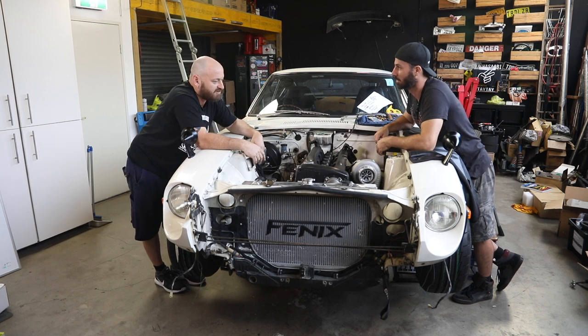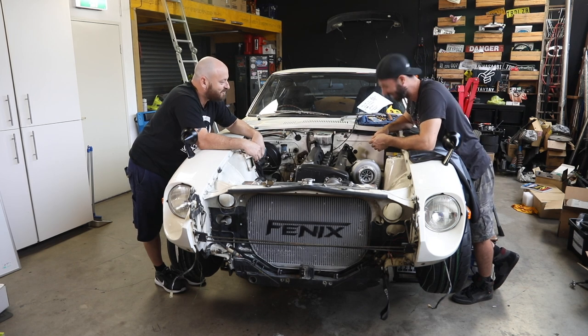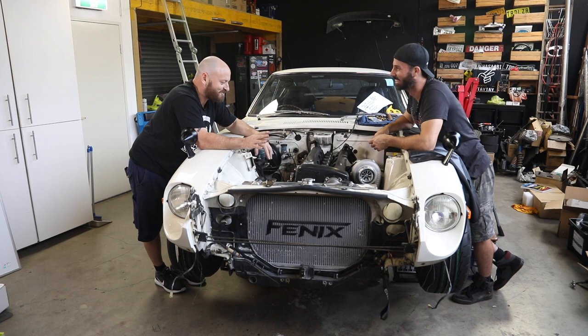Wow. So that's an old trick from the radiator shop. Yeah, nice. You don't want to get blown up by a fuel tank. We don't. It's best to not do it at all. Don't touch, don't weld, don't do anything to a fuel tank. It's a bad idea. Give it to a professional. But we're not welding it. We're actually just cutting a hole in it. But it's just a good idea to purge it of any fumes.